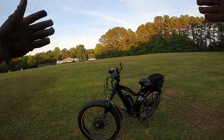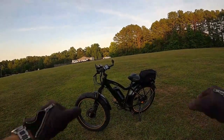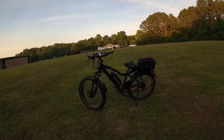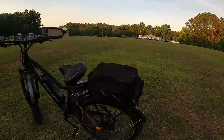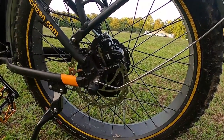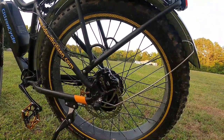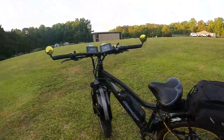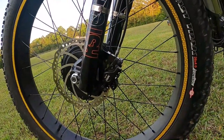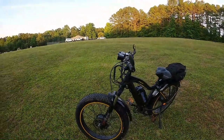I've changed literally everything - the rack and the frame and maybe the seat post are the only things from Rad Power Bikes left on this bike. This is mine now, this is a Citizen Bike. You don't get any more plug-and-play than that - 10 minutes and I had hydraulic brakes on this bike and it looked good. Here's a close-up: the rear - I did not use the spacer they provided, I just took it off and mounted it right on the original mounting part. And the front - I used my original spacer and original bolts from my original caliper.